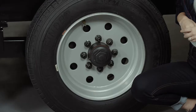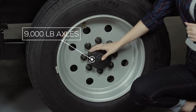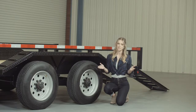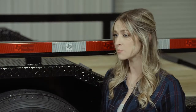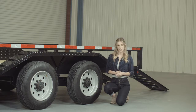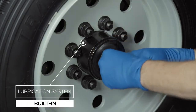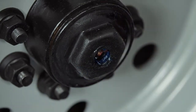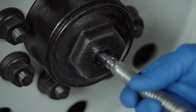For running gear, you have two heavy duty 9,000-pound 8-lug axles with brakes on all four wheels. If you get in a slippery situation, you want all the braking power you can get. One highly important standard feature on these axles is the convenient built-in lubrication system. To fill or top off the central grease reservoirs, you simply pop the hub's center cap off and fit a grease gun over the zerk fitting and fill. Simple and convenient.